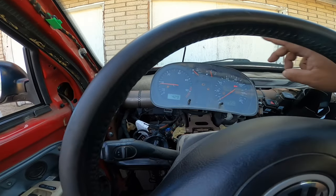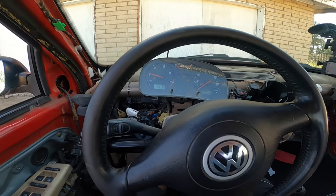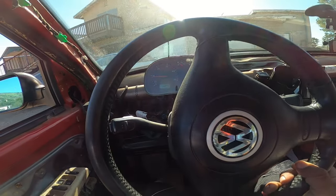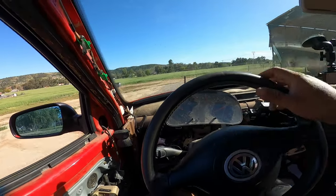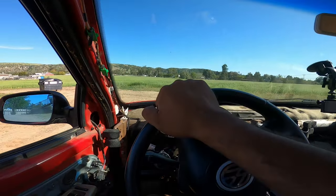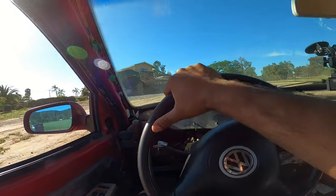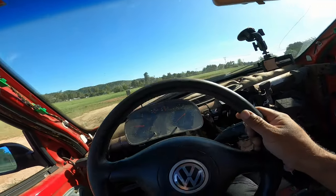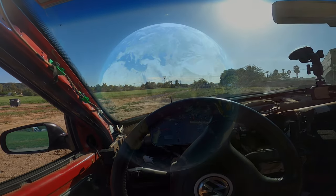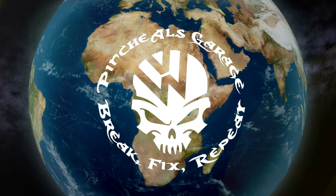Now we're going out for a test ride. You'll see the blinking light — that's because I haven't reset the codes yet. I want to go give it a try and see if the car turns off with the new cutoff solenoid. We did a quick rip in the car and the car didn't turn off. Previously, the moment I accelerated under heavy load the car immediately just turned off — very annoying. But that's it, guys — that's how we fix the fuel cutoff solenoid. Thanks for watching, have a wonderful day!